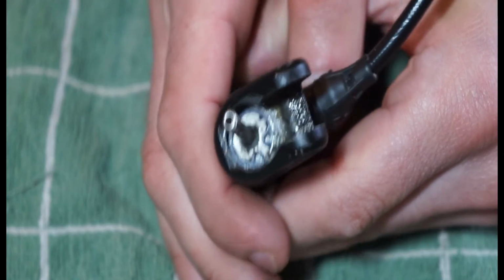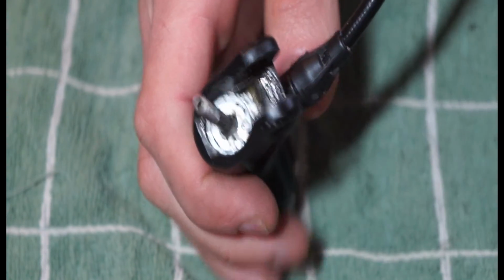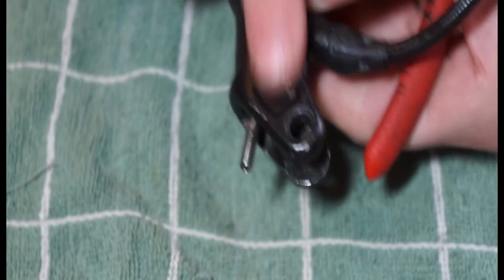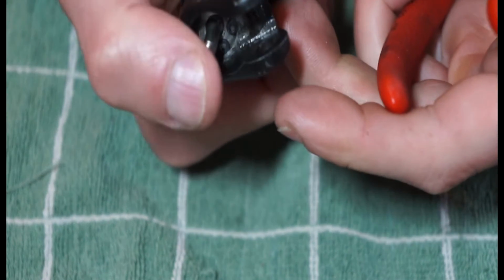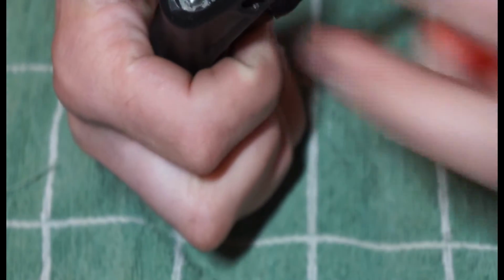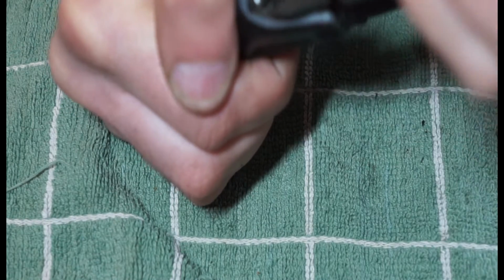There we go. And then there's a circlip in there, so you're going to need a set of circlip pliers. Just be aware that the spring is actually pushing that way, so when you take circlips off levers in general, they can send a lot of this stuff shooting out. You might want to put your thumb over that, or aim it somewhere where you're going to be able to find the parts again. I think on this one it wasn't too bad when I'd done it before. The other way is obviously just keep pressure on your circlip pliers, keep pushing them down as you do it.